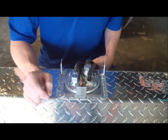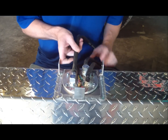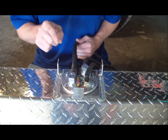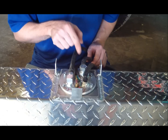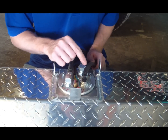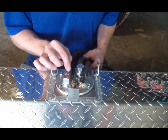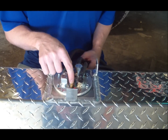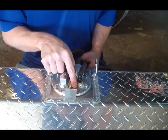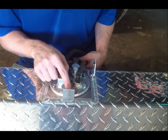The next step is to add your fuel hoses and wiring harnesses. Attach the 3/8-inch hose to your supply line — this is your check valve. The short 5/16-inch hose will go to your vent, and the long 5/16-inch hose will go to your return. Attach the yellow wire, or sending unit wire, to the brass post. The ground, or green wire, will attach directly underneath one of the self-tapping screws of the sending unit.